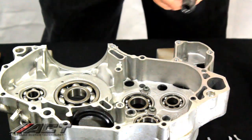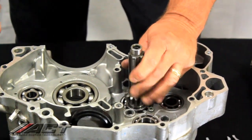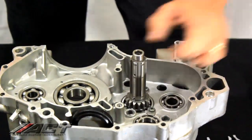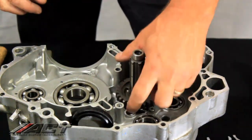So let's talk about how to check for proper clearance of the case there. What you're going to want to do is install the primary shaft — this is first gear which is cut onto the shaft. You drop that in the case. Now you're going to take fifth gear from the primary shaft, drop it on, and obviously now it clears.